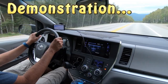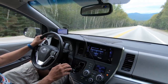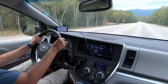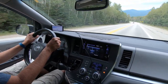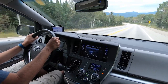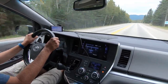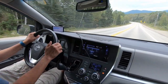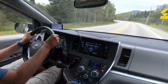Here is a demonstration that I will explain after. In that clip, I never apply brakes. I only use engine braking, which is a good thing, otherwise I would have been applying brakes for a very long time. This whole engine braking sequence lasts 2 minutes 11 seconds. I will accelerate the video, not to bore you. Applying brakes for such a long time will not only wear the brakes, but will also heat them, and they can end up with warped discs.